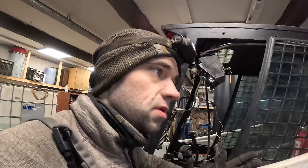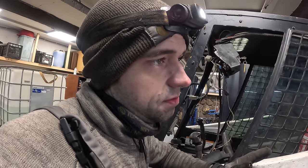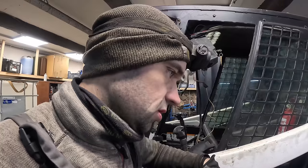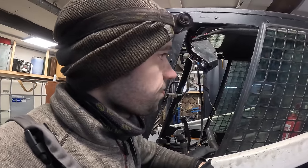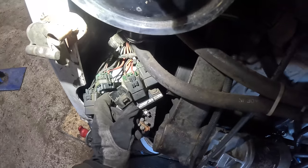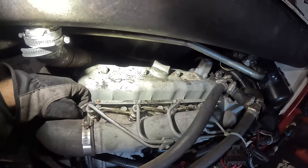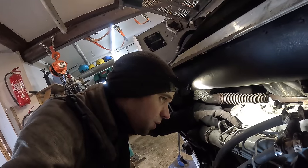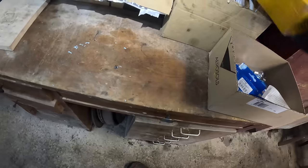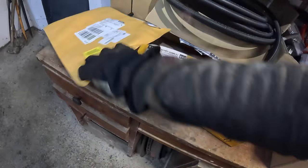Appears to check out. So in theory, if I put some 12 volts on that blue and black line, relay should activate and put some power into the glow blocks, and then they should start glowing and stuff. Definitely gonna test it out. If it doesn't work, then there might be a chance that the relay itself is bad. But let's start from the rear end first. Check the glow blocks, if they will even work. Need order a new glow block somewhere.